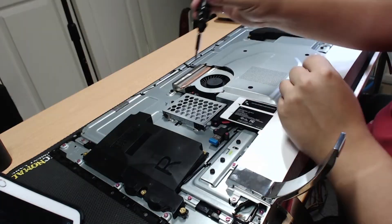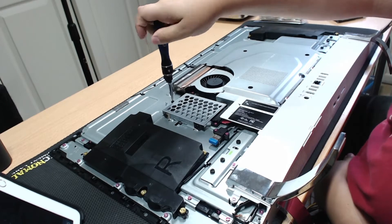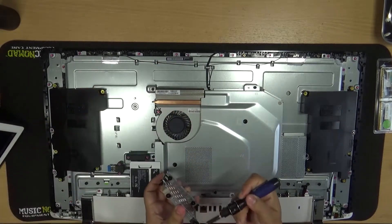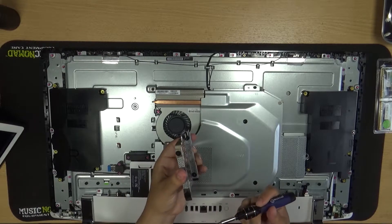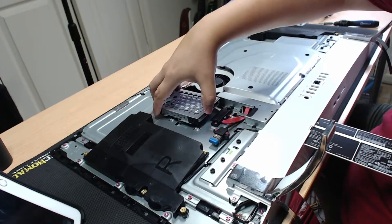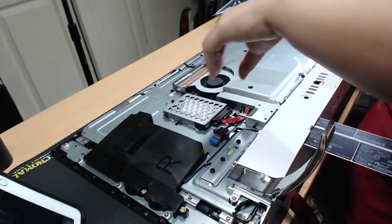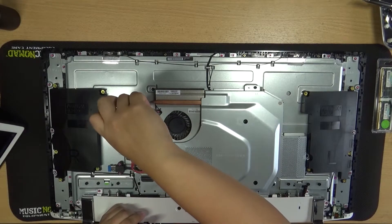To install your new hard drive, loosen the screw at the top of the small cage with the hexagonal holes. This screw is also not meant to be removed completely. Pushing it towards the top of the PC should slide the cage forward, disconnecting it and letting you lift it off. There are four screws on the side of the cage held in by rubber grommets, and these are what will hold your drive in place. When installing my solid state drive, I had to put the drive in upside down so the connectors would line up when the cage is put back into place. Simply slide the cage back under the tabs while making sure your drive goes into the connector, and it should socket in nicely. Screw the first screw back in, and the drive has been replaced.